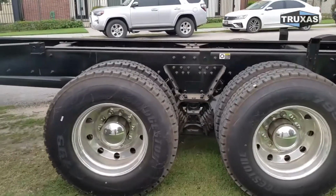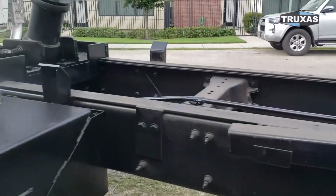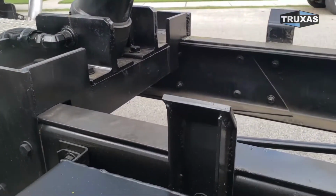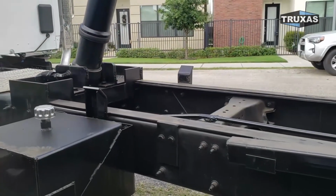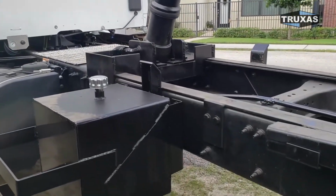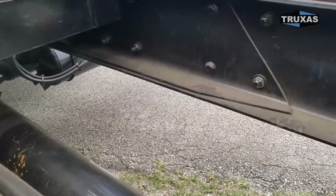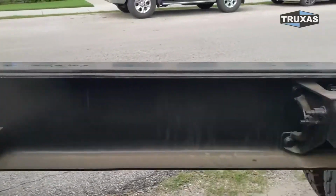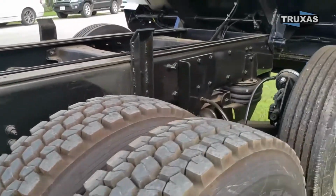Here's the other one. And then these trucks, we order them with a frame and a half. So you can see the frame sleeve comes right past that front hoist base, just because there's a little more twisting that happens right there from that hoist base forward. So we ordered the double frame there, but not on the whole truck. So you can see we got the 1/4 inch, it's like a frame insert is really what it's called. And then the 3/8 frame for the rest of the truck. So we do this for weight savings on these.